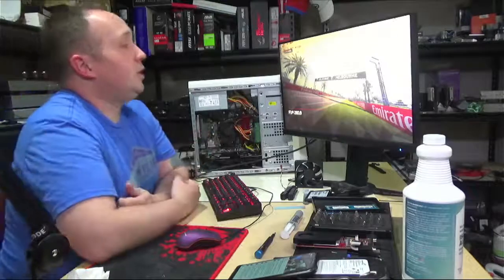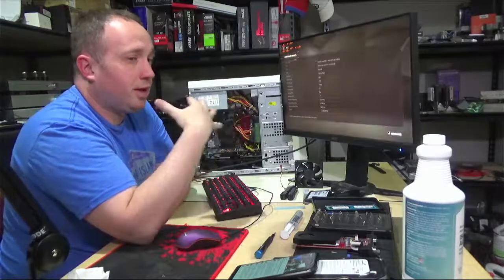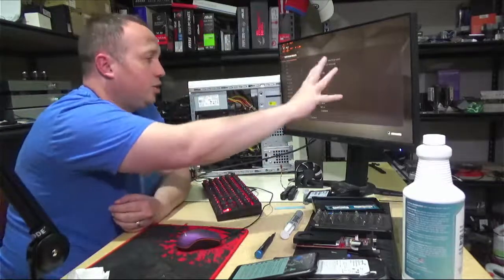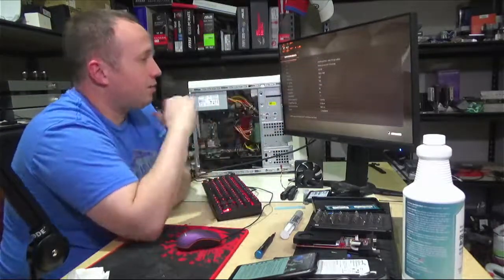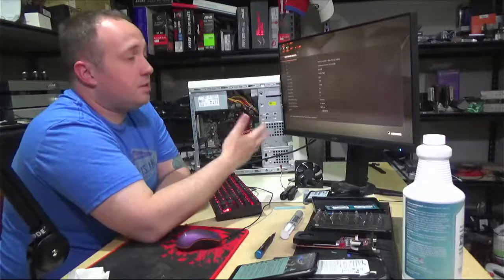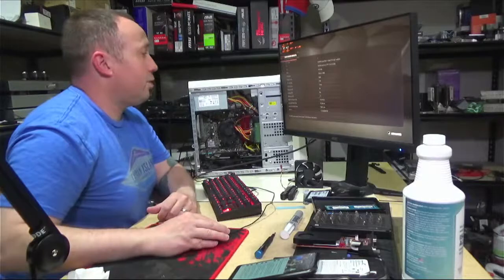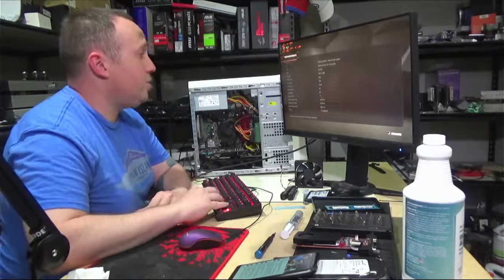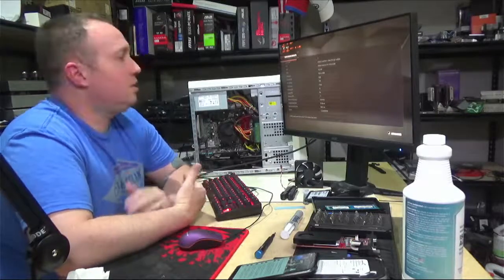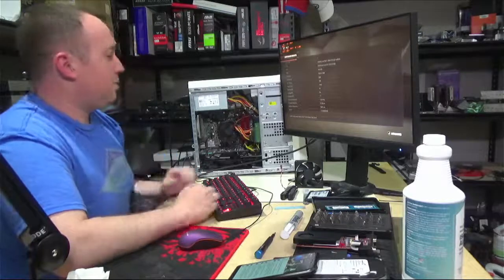So that's good. We're getting that 50% range of CPU utilization, and I like seeing that. That means that we found the good sweet spot for that one game, right? Where you're seeing 50 to 60 on your CPU and 100% on your GPU. It's like a balanced system where these two components actually work well together. So we had a minimum frame of 52, average of 64, and a high of 71. That's actually a really tight spread too, from min to max is less than 20 FPS. That's awesome. I'm super happy with that.